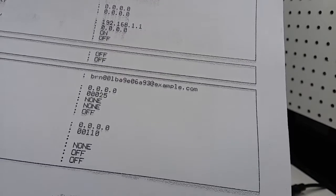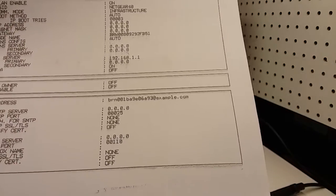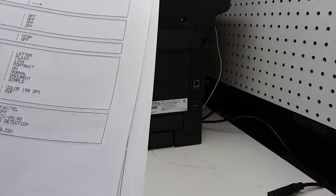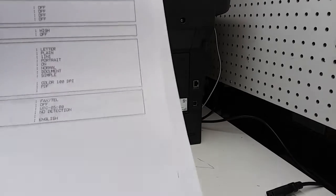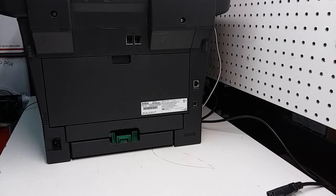So you can see all these papers. I'll bring it up closer. You can see how there's leftover, and it seems like it burnt on the paper well, but the roller is probably failing. So for me, it's best to just replace both, the roller and the sleeve. But the fuser unit is definitely working fine. Inside, the heating element is good because all this is heated on and it doesn't have powder like the toner on it.